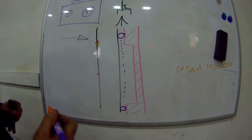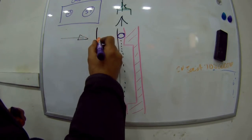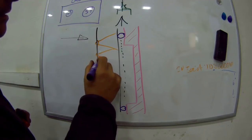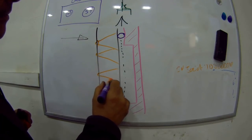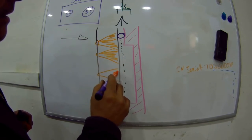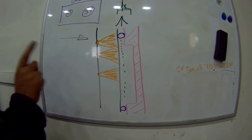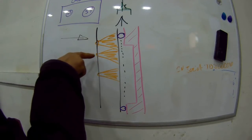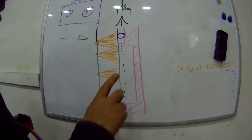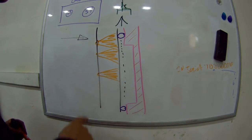But this is the amazing part, what you don't see. I've seen it many, many times, and this is why I don't repair doors anymore. Behind that door skin there is an opening like this. Behind that little blister, all this is corrosion. This is very similar to a bullet entry. When you shoot somebody with a bullet, you get a very small entry hole, but a very large exit hole. This is in reverse. The water's coming down here, and it's corroded all the back of that panel.